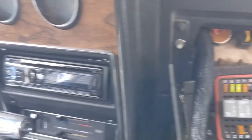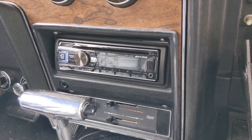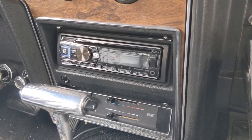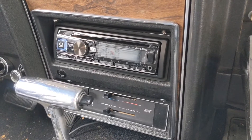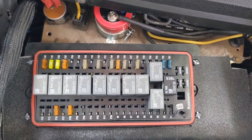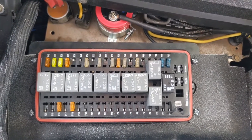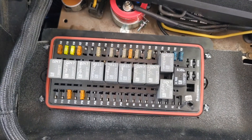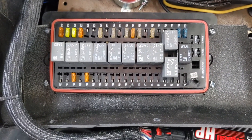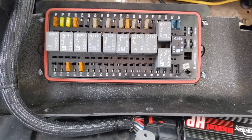Another thing I just wanted to quickly discuss: if you have unwanted noises like humming or buzzing coming through your stereo, you probably should fix that. That's the audible RFI — if you can hear it through your stereo, odds are Holley is going to hear it too, and it's going to give you a whole bunch of problems. My symptoms for RFI were: my O2 sensor would freak out, it would say 'heating randomly' and 'no data,' it would randomly backfire, and a couple of times the whole screen just said no data. Those were my symptoms — everyone has different ones, but the main one is your display showing no data.